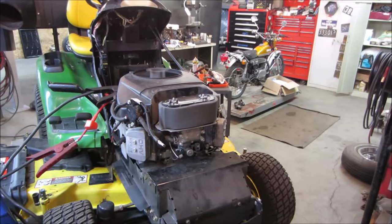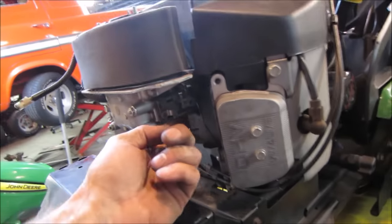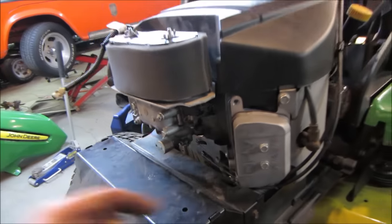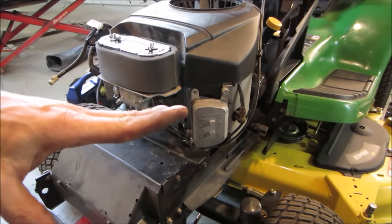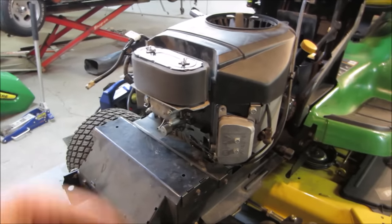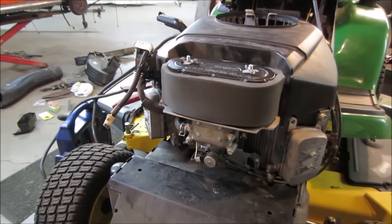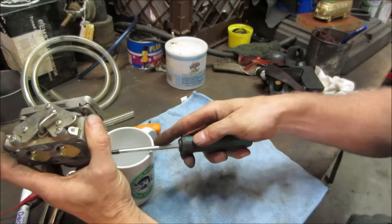It sounds like it doesn't have an idle circuit. I should be able to hold that right against idle. See if it stays running. Yeah, so it's got no idle circuit. And what's happening is, on the higher revs, it's fine, and then it goes back, the governor off, it goes back to where idle is, but there's nothing there in idle, and it drops right off and it gives it full throttle again. Definitely a carburetor problem. I might have sucked up some crap too from doing what I did. We're gonna find out. And back in we go again.